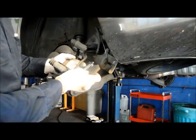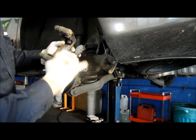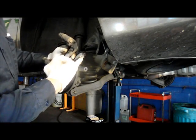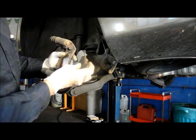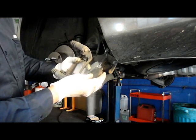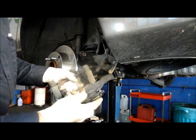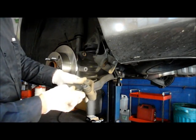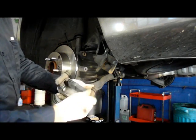When you take the brake pads out, they have the indicator on the back of the brake pad. Make sure that the disc indicator is in the correct position as compared to the one that came out. And then this one here, it's right here, and it's right here, so it's correct. And this one is going to be your inner brake pad. So you can put your pad in here, and it just turns, and it goes right in like that.